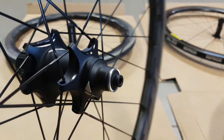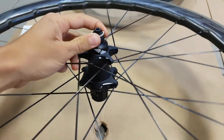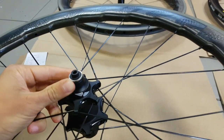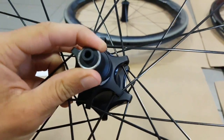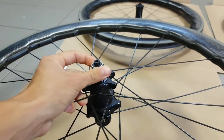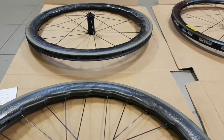One more thing I've noticed about the Zipps: these NSW series wheels have quite tight bearings when new — no play at all, but you can feel quite a bit of resistance initially. I think that's because they've used heavy-duty seals, which is good for reliability, but they definitely need to break in a bit before becoming silky smooth like the Ceramic Speed hubs on the MVs.